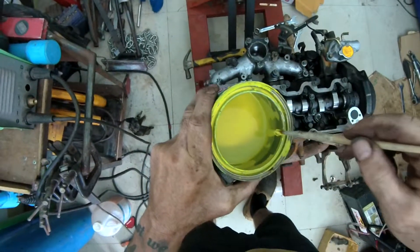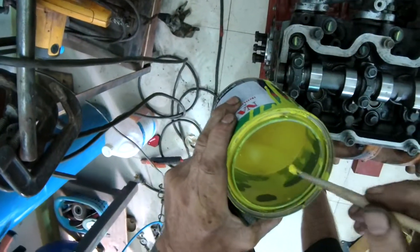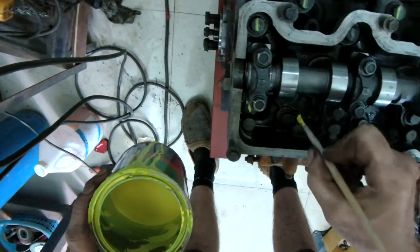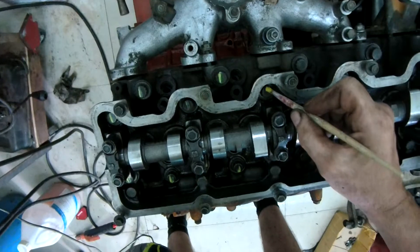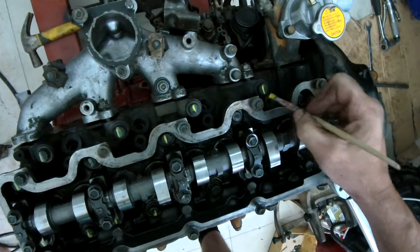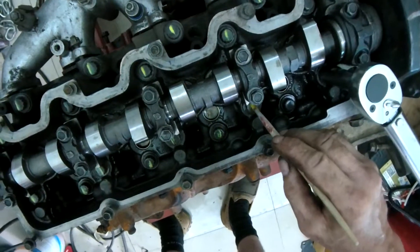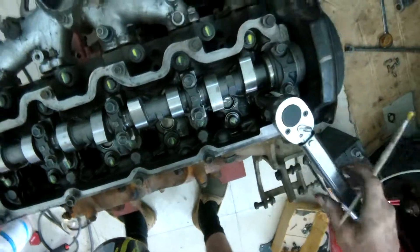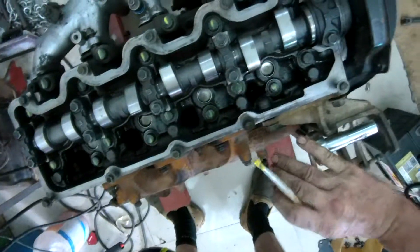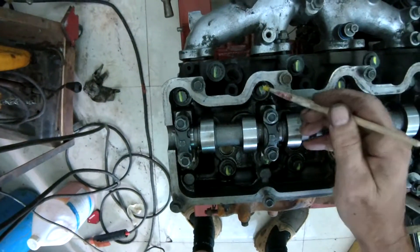They're all done — every 58 pound-feet. Painting the bolts now; it's not the thickest paint in the world, but it's not the best brush either. The idea is to give you an indication of the stretch of the bolts. I've got one I don't like the feel of. Just splash it on — yeah, one of these I'm not 100% happy with.